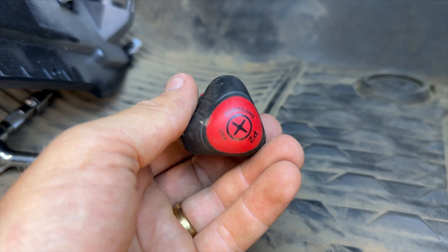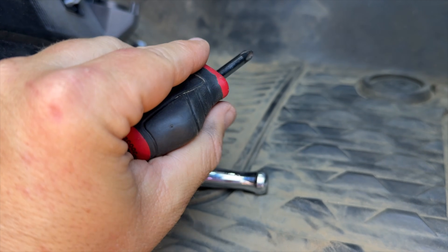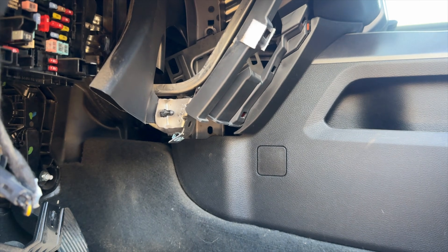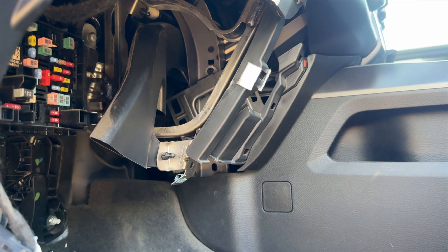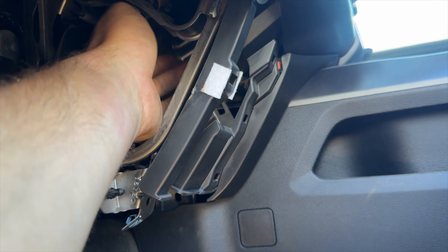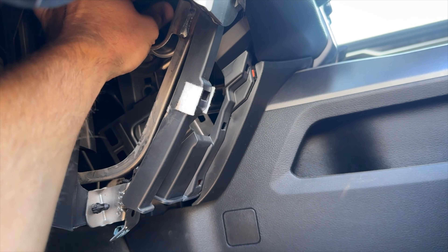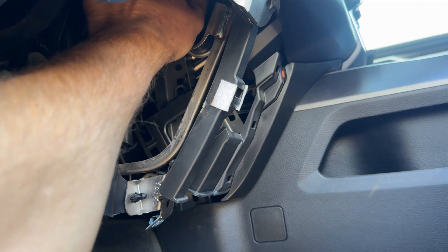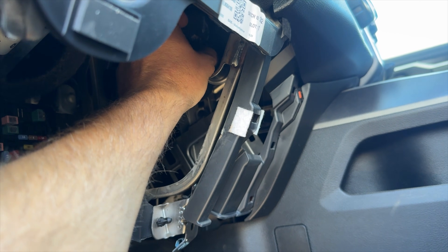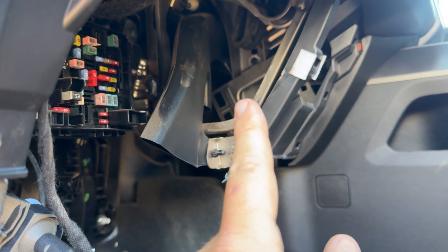The bracket is now installed. Using a short-handled number two Phillips head screwdriver is definitely my suggestion because it's a tight place to get your hand in there to tighten those screws. Once those are in, you have your bracket installed. Now I'm going to reach up into the dash area and pull down this bundle of wires — right here are the pigtails for the harness controller. Just undo the tape and pull those out. There are only two plugs and there's no way to mix them up because they're different sizes.